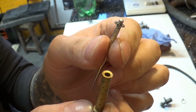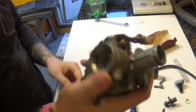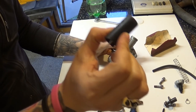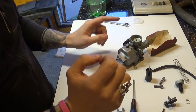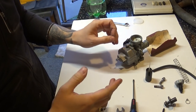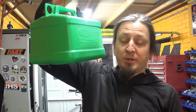So we've got the original carb — the old one, fully checked and rebuilt — with the needle raised by one notch. I'm going to put this carb back on the bike because it was running slightly better with the original carb anyway, and I want to keep it simple for now. The last piece of the equation is getting some fresh petrol. Catch me in about seven minutes.